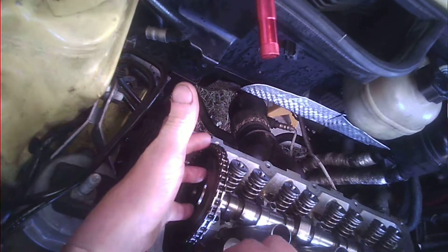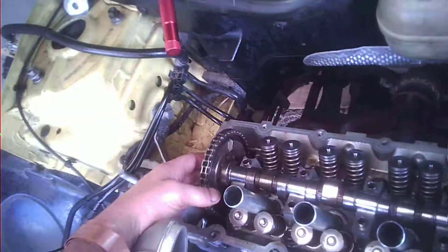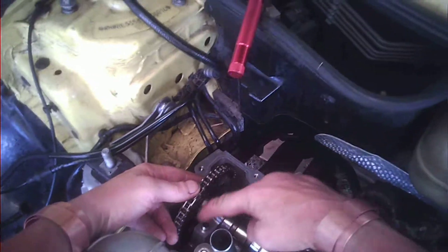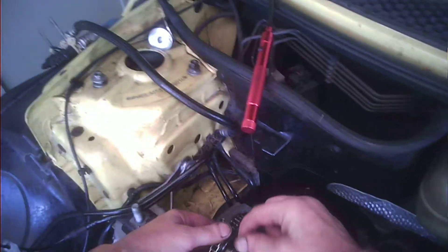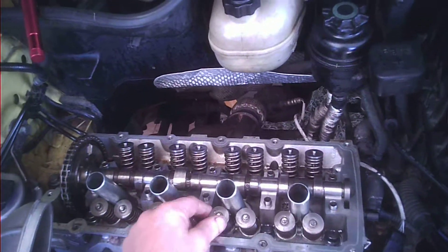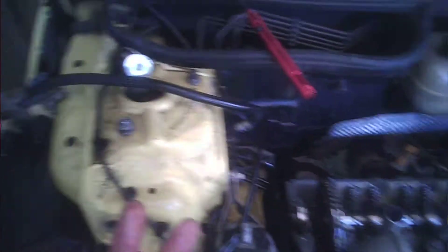When I get it in there, I just snug everything. When I go to tighten this bolt, what I've been doing is taking a screwdriver that's really tough steel and going through this hole, letting it rest against the bolt and the bolt on the cap to hold it in place. It's such a small fulcrum that you can put plenty of force on it — just hold it in place and pull it tight. That's how you do your cam timing without having to take off your timing cover, your pulley, mark up these teeth, and do that whole rigmarole.